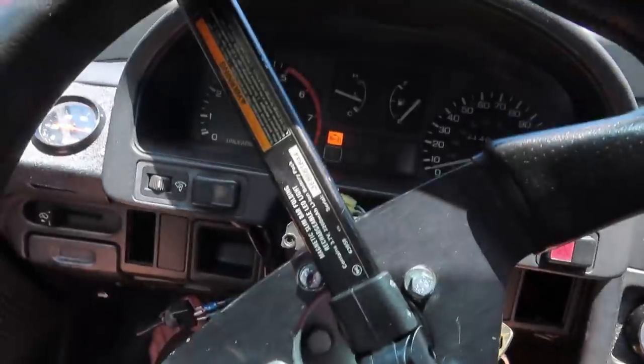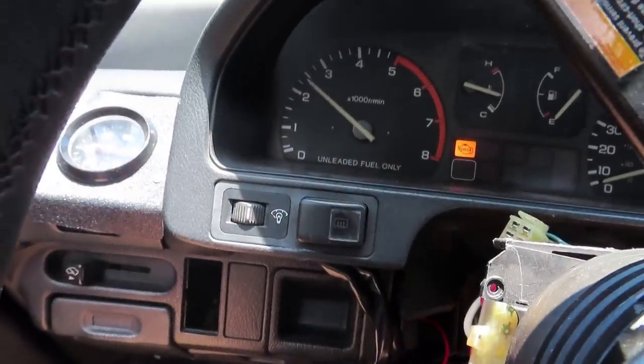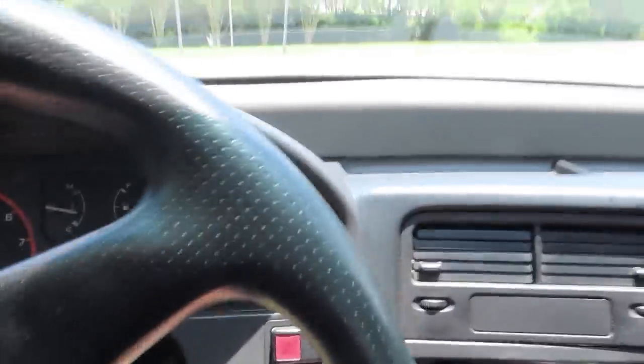But with that, now I have a much higher raised RPM at idle. Before, it wanted to die out at like 1100 or 1200 RPM, which is what I set the idle, dying out. Now it's the same settings, same throttle screw and everything, and it's right over 2000, which is funny because that's almost the limp mode limiter on this.